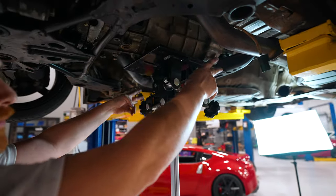I noticed as I come off the clutch pedal, it's right off the floor, and what that could be an indication of is it's releasing the clutch enough to where I can change gears, but it might not be all the way, so it might be dragging a little bit. You really need to have the last quarter of your clutch throw towards the floor be free travel. When I'm coming off the ground, it shouldn't be engaging immediately. It should be a third to halfway up. So let's get underneath it, adjust it real quick, and be on our way.